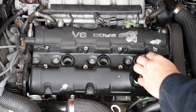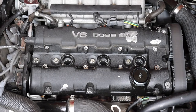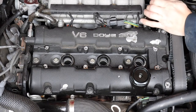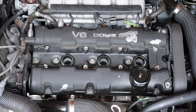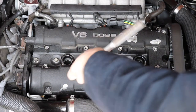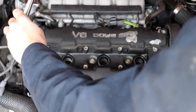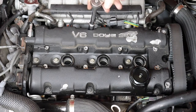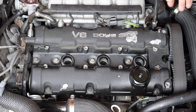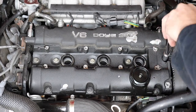People who do their own work do make mistakes like that from time to time. It looks like the previous owner just failed to tighten these to spec. Thank goodness he didn't do that on the rear valve cover — I might stick a wrench in there to check. Those are definitely tightened. Well, let's just loosen these up. You don't need to put a lot of torque on these valve covers, but you've got to put enough — you've got to hit the spec so it's pressing down on that gasket. Gaskets, even over the course of a year or a few heat cycles, deform a little bit. You've got to tighten these things down.